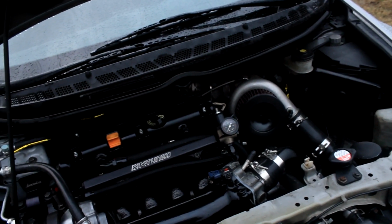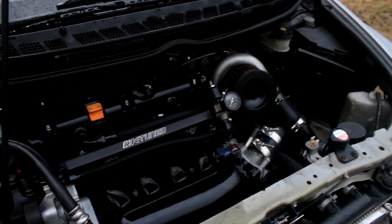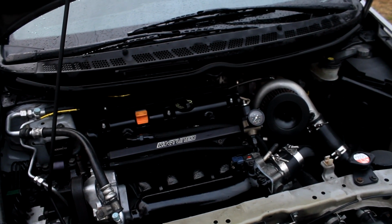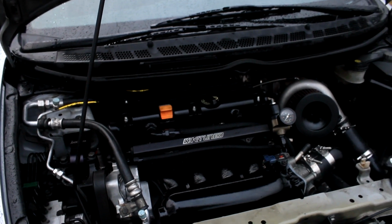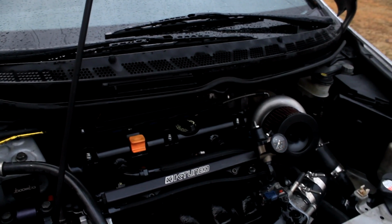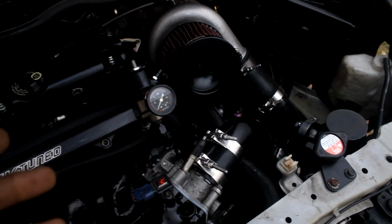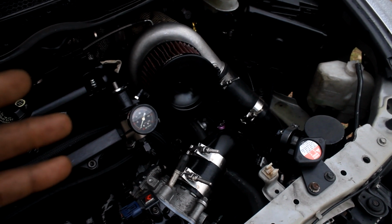I think it wasn't surfaced properly, and you cannot treat a twin disc flywheel as just a regular clutch flywheel. So I think it may be warped. Hopefully nothing is loose. Hopefully it's not the transmission, because the transmission is effing expensive.